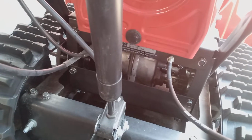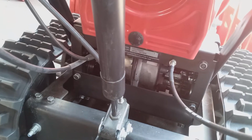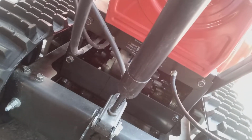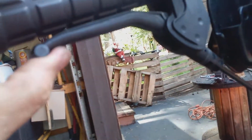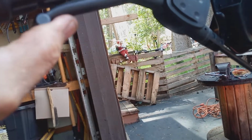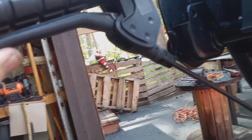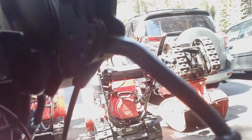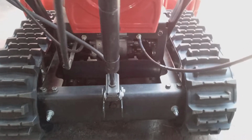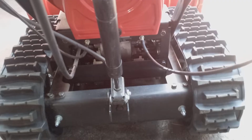It's a chain drive. It's an independent chain drive. You got a chain for one side, and you got a chain for the other side too. So it could be the chains. I'm just guessing. This locks up your track. See, when you pull this in, the track stops. Now the odds of both tracks stopping at the same time are probably slim. So could it be the cables? Could it be these steering cables? Something's not engaging the transmission shaft, so the tracks won't move.